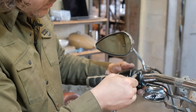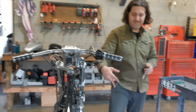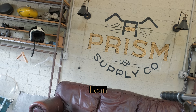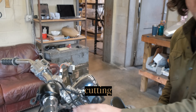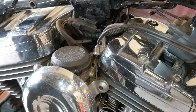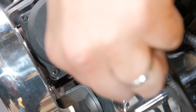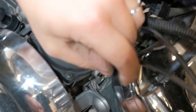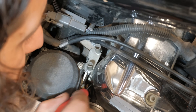Back to the Torx T27. The turn signal is the only thing holding us together at this point. We're taking the throttle side off now and we're going to use new cables and everything, so I'm going to disconnect it from the carb. You can give yourself some slack by adjusting up here, and then pop it up over — that gives you plenty of slack to remove the barrel. Do the same to the other side; this one's going to have a spring in it so you've got to bring the spring up to get it out. And then you can pop it up over. There it is — she's free.